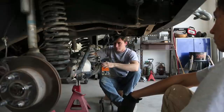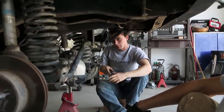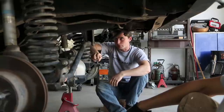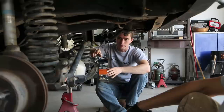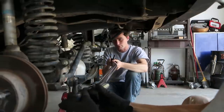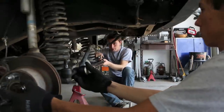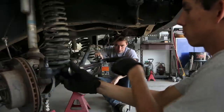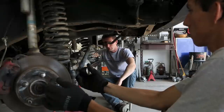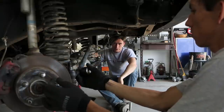The stock steering components are out of the way and the new tie rod is going to go from the knuckle right here to the one closer to you in frame. Most people will run this kit on the bottom side of the knuckles; I'm hoping to get it on top. We're trying to clear the sway bar connects, and if necessary we'll cut them out of the way. The way we'll try to avoid hitting them is by bending the tie rod. As you can see, as it moves, it contacts that sway bar bracket, and same deal on the other side — it hits just before the steering stop. So we're going to move our bends out closer to the end and a few more degrees to hopefully clear these brackets without modifying them.